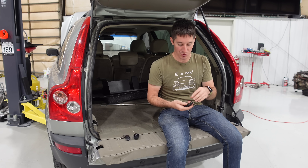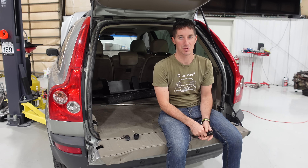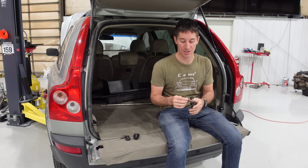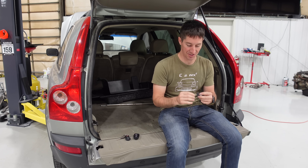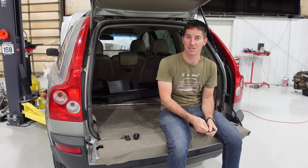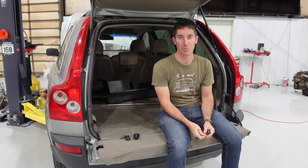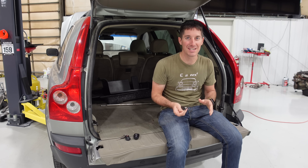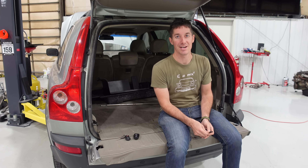One of the earliest systems beyond toggle switches is on my 1994 Camaro — the GM VATS system. VATS puts a pill in every key. Back in the day people were talking about computer chips in their keys that nobody could copy, which created this theft-proof ideology. The thieves and techs didn't care — they all knew how the system actually worked.